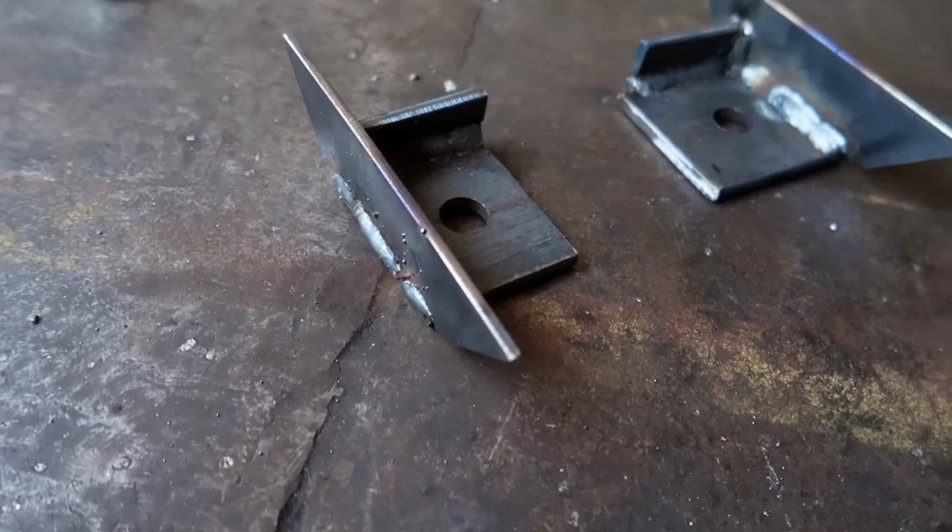With the T-nut mounts all drilled in and dry fit, we're now going to change gears a little bit and work on the internal framing. Each piece of the frame is attached to the plywood with exterior grade wood glue and countersunk deck screws. The frame members are attached to each other with wood glue and pocket screws. So it was basically glue, screw, and repeat, and the frame came together really nicely.